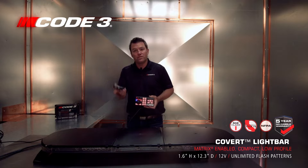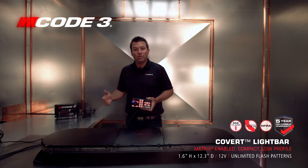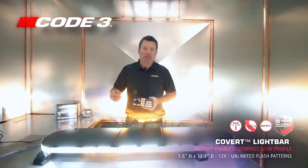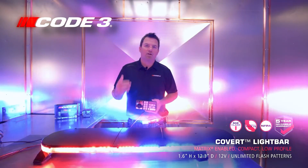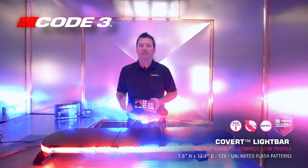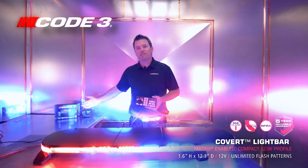If you choose, you can use the serial interface — the SIB — to integrate anything that's Matrix capable. So you can take the siren and add any sort of inputs you want: directionals, hide-a-way, blast work lights, your CD 9215. It all syncs and works together for any function you want — door cut, blinker, horn. Any feature on the bus of the vehicle through the OBD, the siren can listen to it.